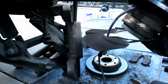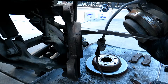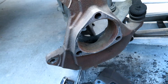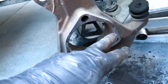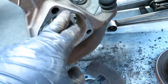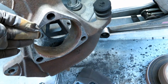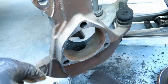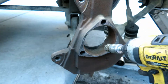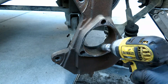Just want to remember that this is the layout of the dust shield. I'm in California so I don't have to deal with rust like the East Coast and the North of the country, but if it's pretty hard and the hub doesn't come out, it's because it's rusted to this mating surface and also this interior. That's what you're going to be fighting and what you'd have to try to pry on the hub to take it off. This is a clean truck since it's California. If you are on the East Coast, you're going to want to take off the rust — just go to a wire wheel and clean all the interior.